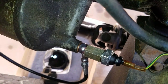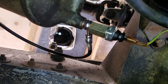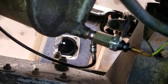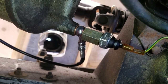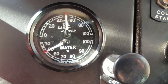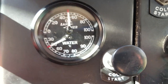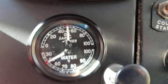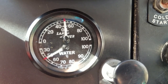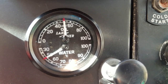Here you can see I've hooked up the banjo bolt and the through bolt, and on the end is the oil pressure switch — that's what's right there on the end. That should all work fine. I'm going to give it a test now and see how it works. The engine's running — I just started it up. You can see I've got about 50 PSI on the oil pressure and it's running at about 50 degrees centigrade temperature. This oil pressure and water temperature gauge is working perfectly and everything's hooked up great.